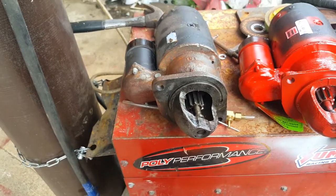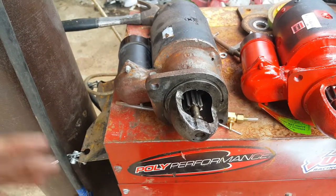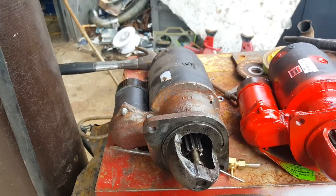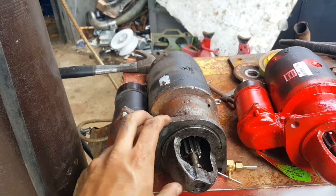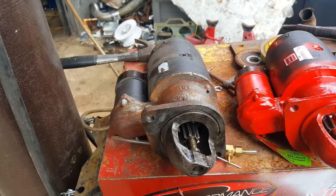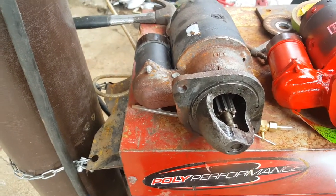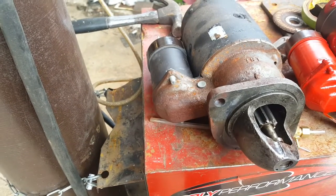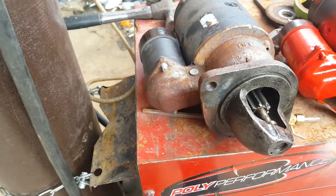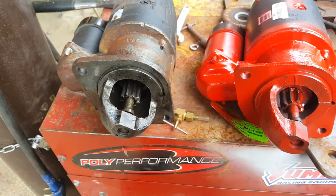And I've got two brand new batteries, and they're huge batteries, so I know the batteries can't be the problem. I've measured resistance across the wires, and the starter wires, one of them, the positive, is actually 1/2 inch thick, so the wire can't be too thin. I measured for resistance, so I know that is not the problem. That shouldn't be the problem, at least unless something really weird is going on, which again is possible. The scientist always assumes everything is possible, even the impossible.